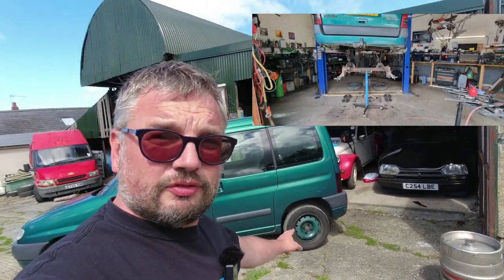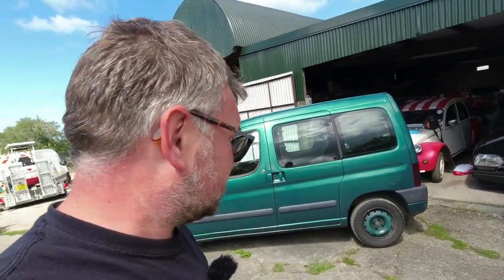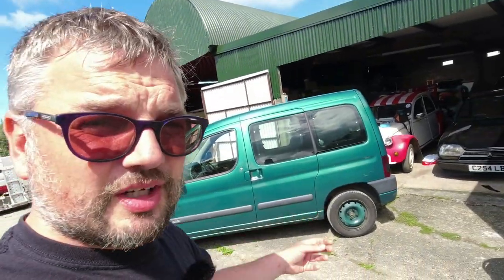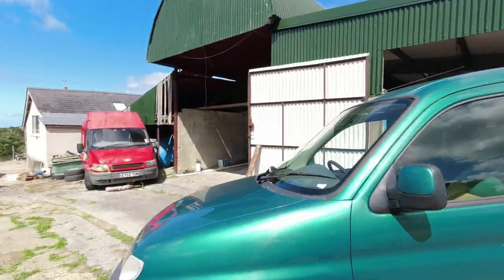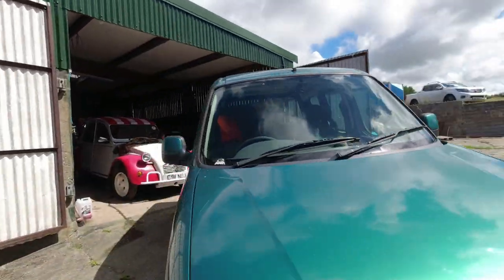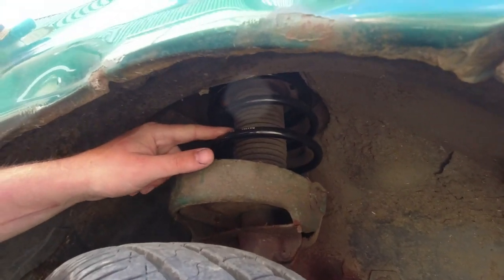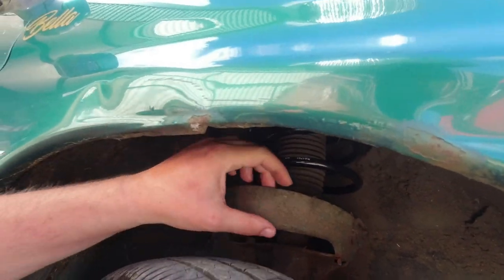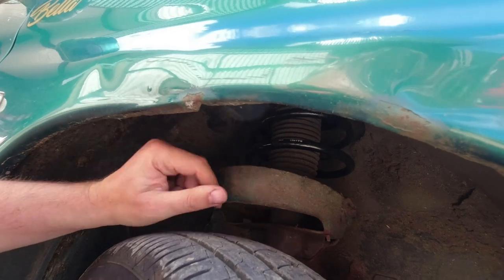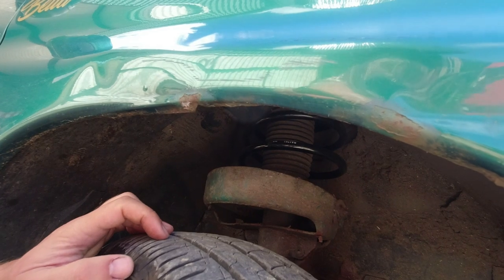While doing that work, the mechanic discovered the rear brakes weren't working at all. He wedged the pedal down — the fronts locked but the rears could still be spun by hand. So new rear wheel cylinders went on as well. And when the car was in for the cam belt and up on the ramp, they also noticed another common fault: a snapped front suspension spring. This one has the modified bottom cup fitted to try and stop the broken spring embedding itself in the tyre.